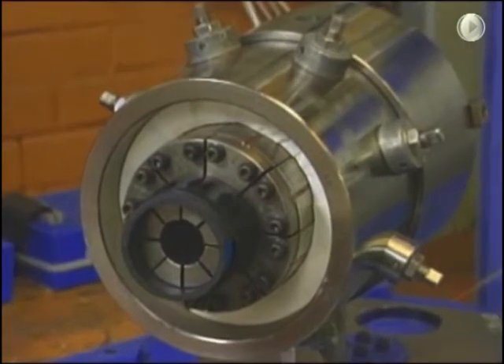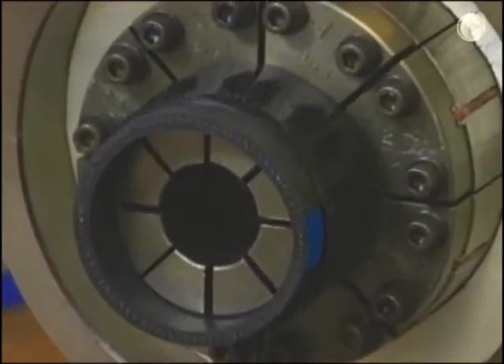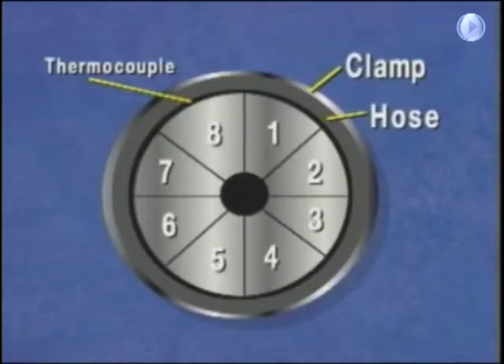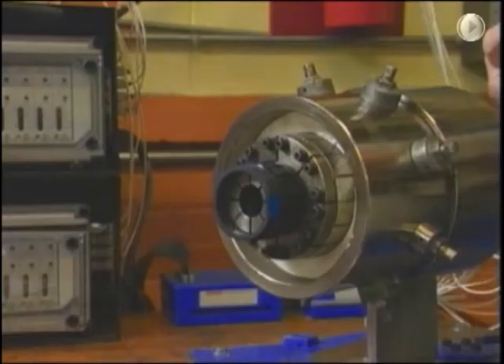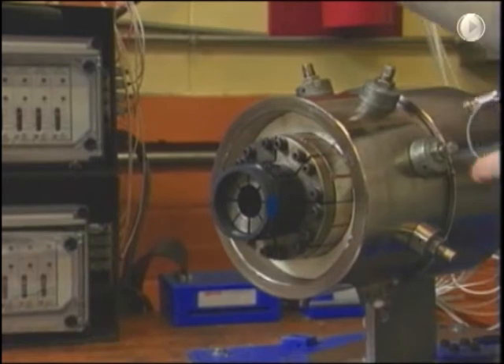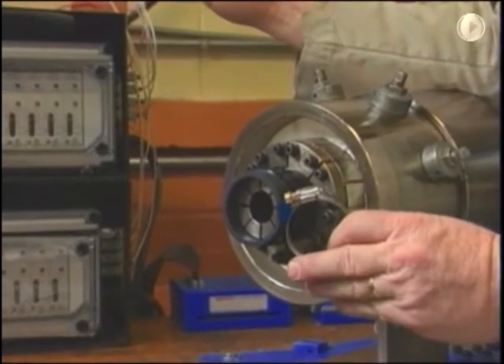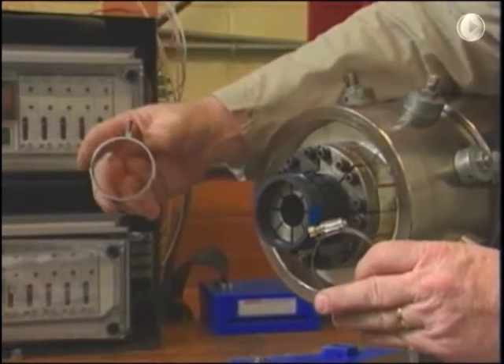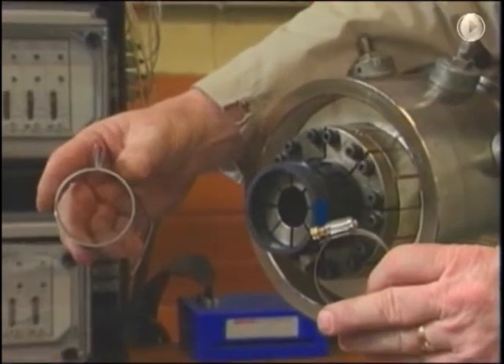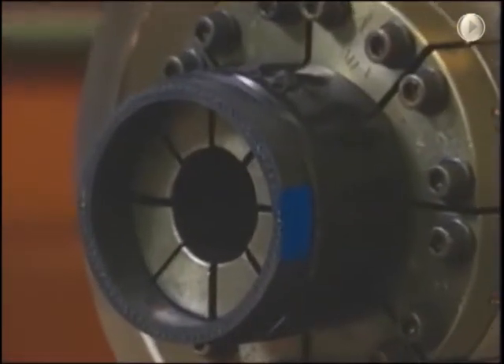The apparatus is designed to measure the grip on hoses and fittings by a hose clamp at eight positions around the circumference of the fitting. A pressure measurement cell is located at each of the eight sectors around the tester. A hose was clamped to the tester using each of the three types of clamps: a 1.75-inch screw or worm drive clamp (constant dimension), a 1.75-inch spring steel clamp (constant tension), and a 1.75-inch Power Grip SB polymeric clamp.